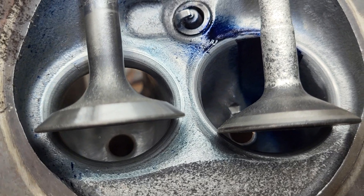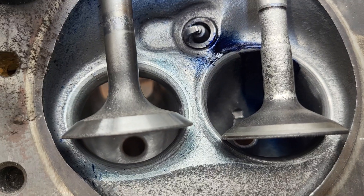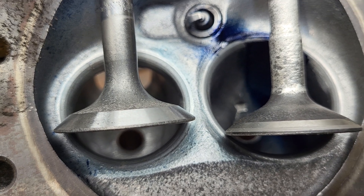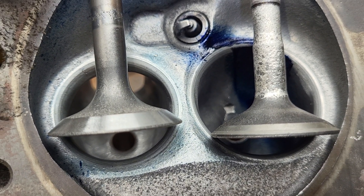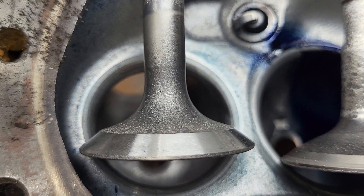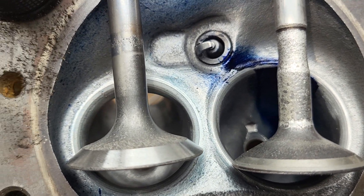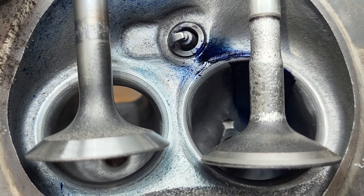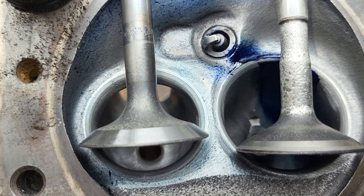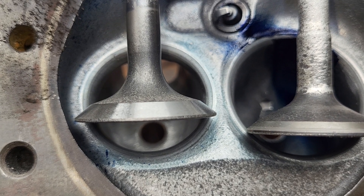Okay, I remembered I had a different 318 valve around somewhere, so I dug it up and I put DB's valve angle on it. The valve on the right is the one we just flowed — the last cut, which was the third — and we went to the nail head design for the fourth. We've done it before on these; I don't remember which one was better — I think the nail head was better. But I've also changed the valve job and stuff at this point, so I figured it was worth a try before I go back and reset it to an easier valve job.